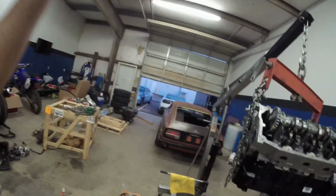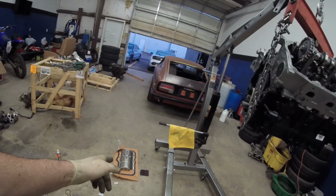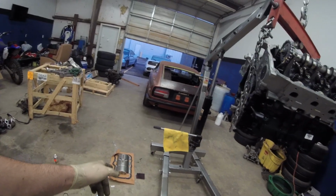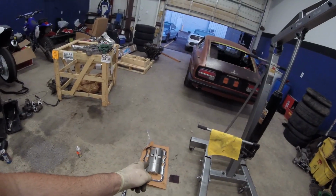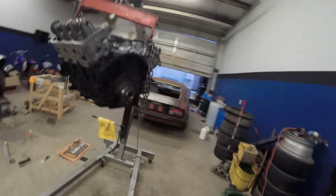And I finally got things to where outside again, the weather stopped, got the bottom of the engine cleaned up, getting ready to put the oil pan gasket on. The way it works is that counts as a windage tray as well for the underneath. So I'm gonna put some RTV along the bottom of it, put the gasket on, the oil pickup tube in, tighten it down so that holds in place. Then RTV the pan, put the pan on, and stick it. So that is what I'm up against. It's tedious stuff. I hate doing this crap, but it's got to get done.